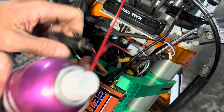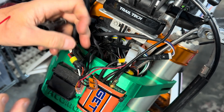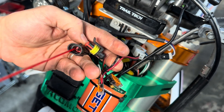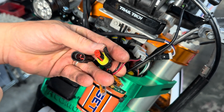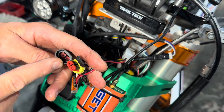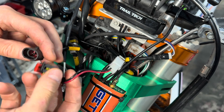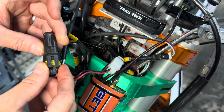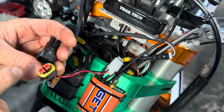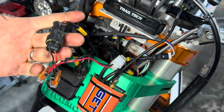You can even use this on sealed-type connectors. What you do is spray this, take your connector apart — this could be an ECU connector or any type of sealed connector — spray that in there, and you could do both sides if you like. Then take a little bit of compressed air, just a bit, and blow out all that liquid buildup. You don't want drippy, runny pools of that in there, because that will essentially create a little bit of a hydraulic lock. That fluid takes up space within the cavity and may prevent you from inserting and sealing it all the way. Just a little shot of air to blow any of that out, then go ahead and do your insertion — that's the ideal way to do it.